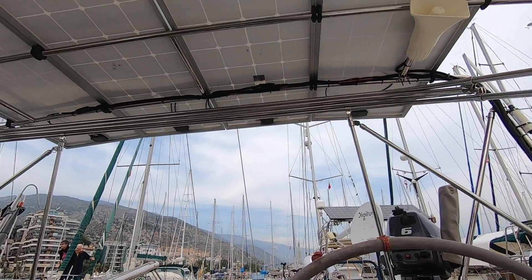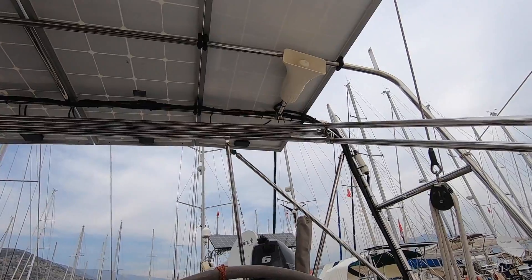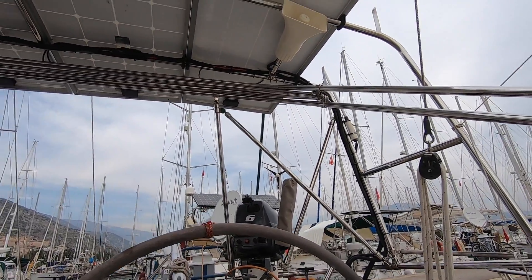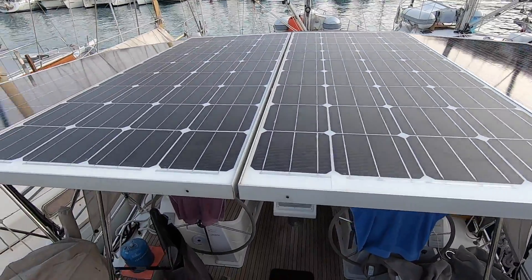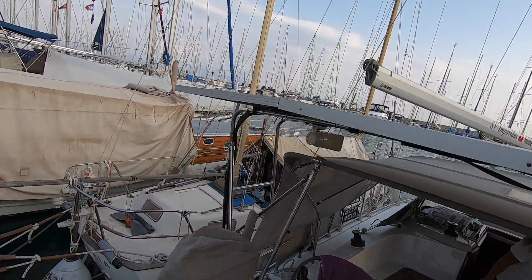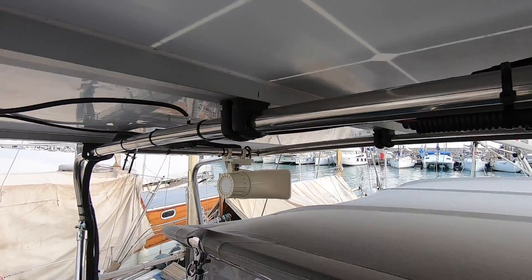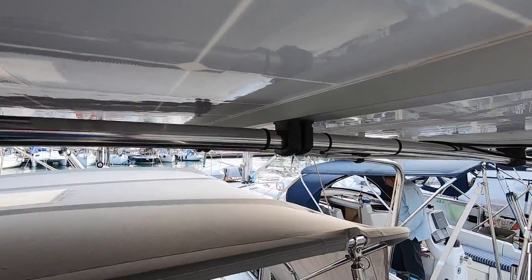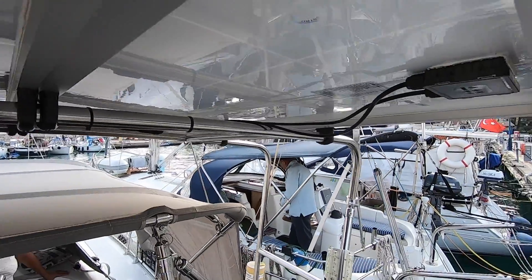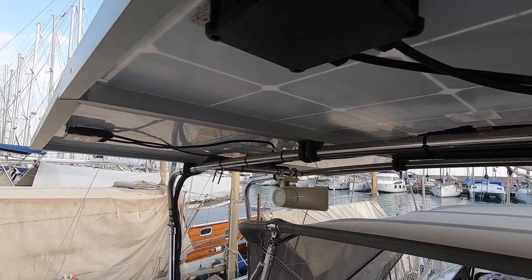At this end we've got all our conduits in, tied back nicely. Got to straighten up the horn there and put our lifter back on. Job done. I'm probably going to put an aluminium rivet in the old mounting holes for the centre. These plastic clips we used to fix the outer edges isolate the stainless steel from the aluminium, although we have used a stainless steel screw into the frame with a little bit of silicone grease on it to stop it corroding.